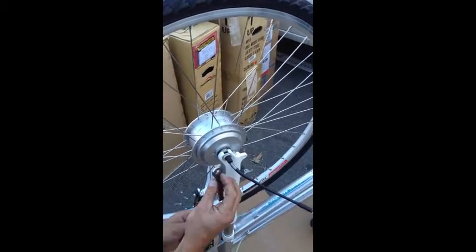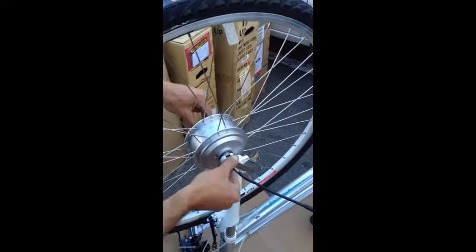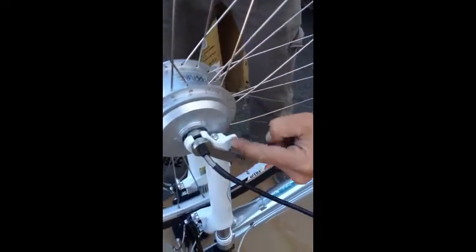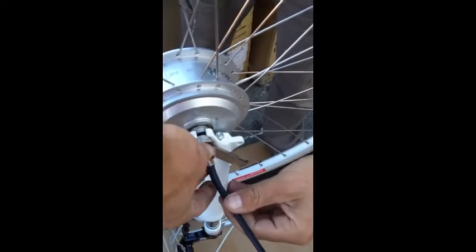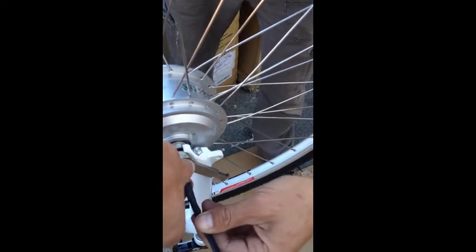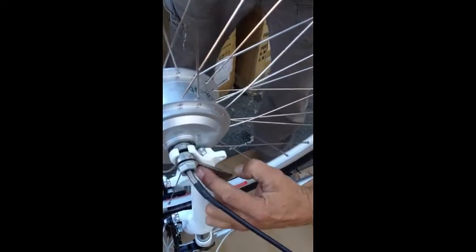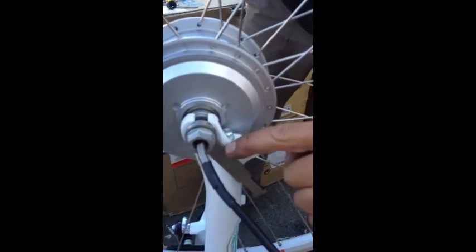The first thing we'll do is put the torque bar on. You can see there needs to be a bend around here because it's touching on the fork. Getting the bend is quite precise. You need to get it right where the axle nut goes in. You don't want to put the bend too close to the axle nut because then you risk stripping the nut when you tighten it. But you can see you need the bend to be right at that point — no closer and no further away.